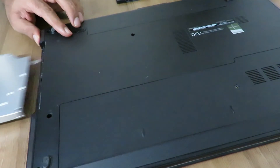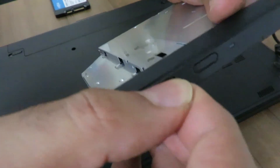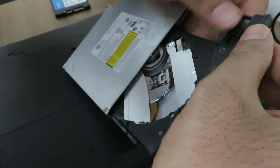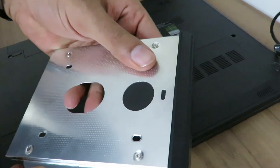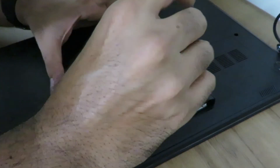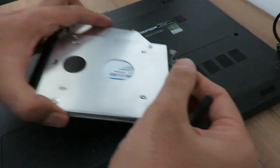Next, we will open the optical drive — again just one screw. The optical drive has a cover on its front; we'll have to remove this so that we can put it on the HDD caddy. The HDD caddy does come with a front cover, but the original would look and feel better. Stick a safety pin in the opening near the eject button and the optical drive will slide out. Carefully pry open the front cover — I had to struggle a bit but managed to take it off without breaking it. Stick the front cover on the HDD caddy and make sure it fits properly. Then slide the HDD into the caddy and use the screws provided to fix the HDD in place. On the optical drive, find the small bracket that holds it in place, remove it, and attach it to the HDD caddy.